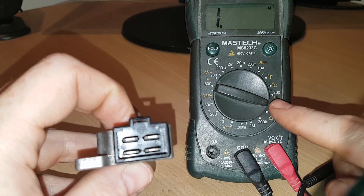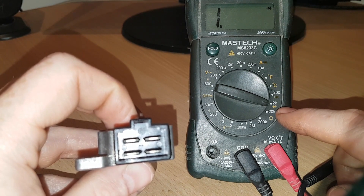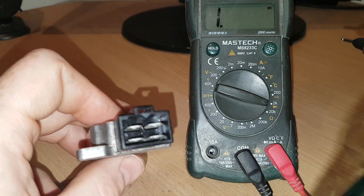What I've got here is my multimeter which I'm going to use for the offline test. It's set to the diode function — you can see the little triangle here with a flat line in front of it. What we're going to do is test consistency in the diode boards.